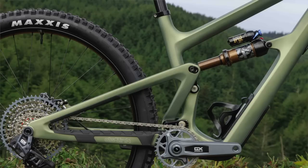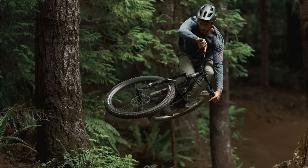We're able to do that by moving the links around, which gives us a little more flexibility in link placement. It's still the same carbon swingarm — we didn't make five swingarms — but it's more complicated than just moving the swingarm forward and backward. Moving the lower links creates the size-specific geometry, and the seat tube moving also moves the upper links. We also moved the shock mount to compensate, so they should all ride the same.